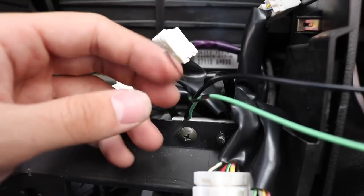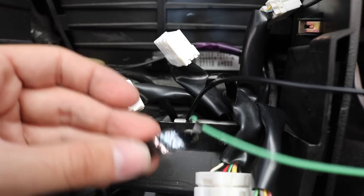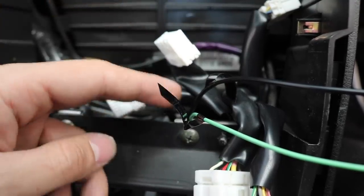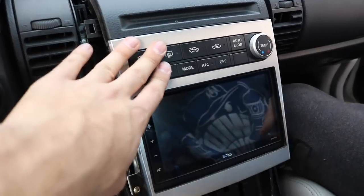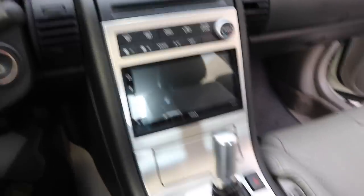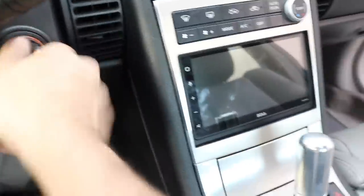Due to legal reasons we can't play movies or watch anything without the parking brake on, so what we did to overwrite that is just put it to ground. It's been about an hour and a half and we had to do a lot of cutting to the double din — it's been a mess. I believe with the Metro kit it's obviously for the USDM market so it's gonna be a better fit. We did have it hooked up and we had to drill a hole in here, but this is how it looks when we first turn it on.